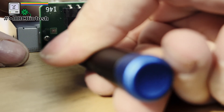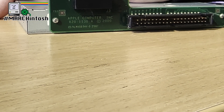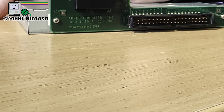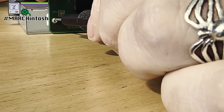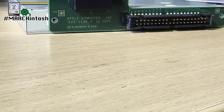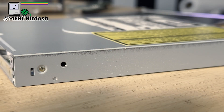With the DVD now free, we have to remove the card on the back that connects the power and IDE connectors to this tiny little drive. You'll need a small Phillips head screwdriver. It's undo two screws — they're very tiny, so make sure you keep an eye on them — and then the card just pulls away. There are also two tiny little screws on either side of the drive case, so just carefully undo one and the other, and then you can lift it away and it should just open.